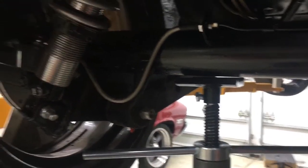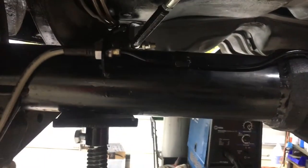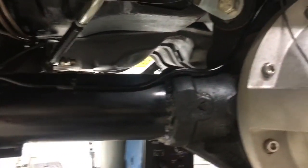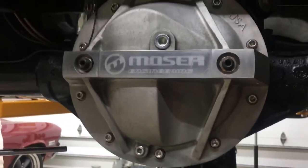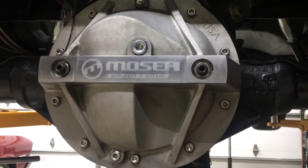The QA1 and disc brake conversions are all in there. I still have to add the bump stops — I need to put those back on. What I did yesterday was bend up some brake lines and weld on those little tabs for the hard line to stainless flex line. Decided to paint them just to make them all go away. So that is the upgraded 10-bolt differential, and hopefully that works out.